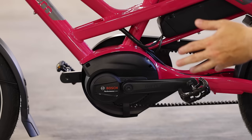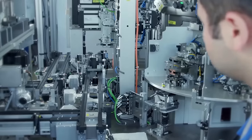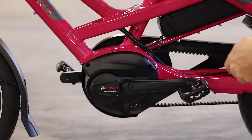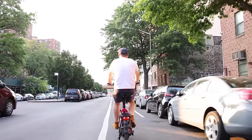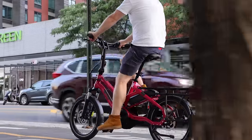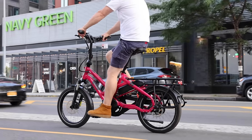The Bosch pedal assist is really better than most others on the market — in my opinion it's the best, though I'm a bit biased since it's all we sell, partly because I feel they're also the safest. They really don't mess around with safety. One little detail: they're actually privately owned, and effectively 92% of their profits go to charity — a little strange but I encourage you to look up some of the history. They use three different sensors, sensing how fast you're pedaling, how hard you're pedaling, and how fast the bike is going overall. Based on that information, it provides assistance proportionate to your input, creating a really seamless experience. With the new Smart System, you have Auto Mode where you don't even have to change the assistance — it really predicts and gives you exactly what you want.